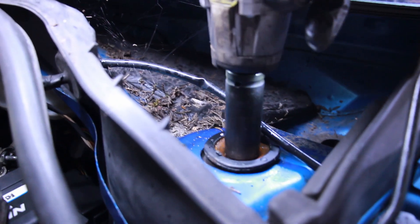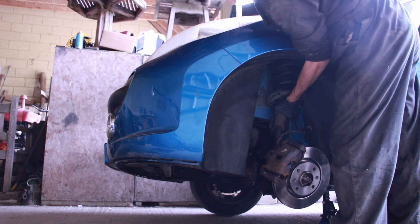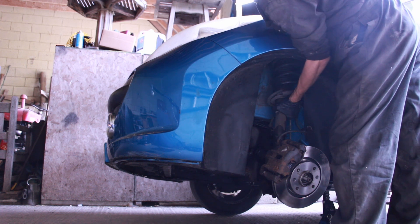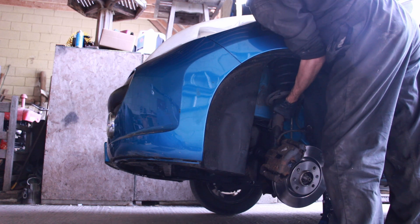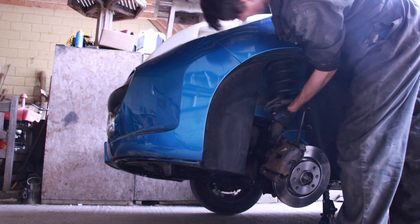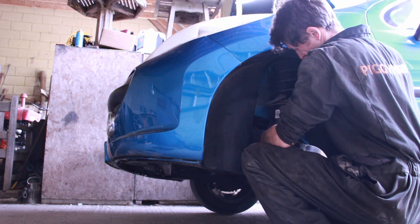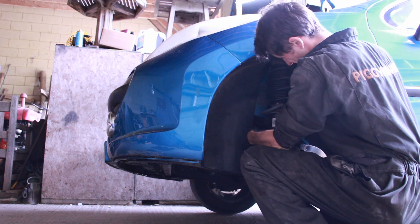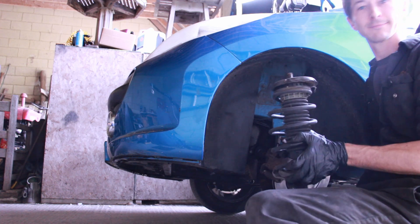So 21mm. Now before we get too excited the strut will of course now fall out if I just leave it like that, potentially damaging something. So we hold it with one hand and undo that nut with the other hand until the strut is free. It's got a nylock nut on it by the way. And she's come out — super job. You can normally just leave the nut in the recess on top of the car; it's not going to go anywhere. A bit of a wiggle and a jiggle to get the strut out without damaging any ABS wires or the hose.